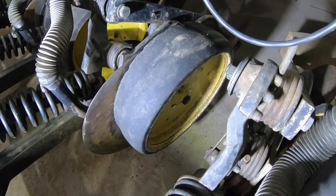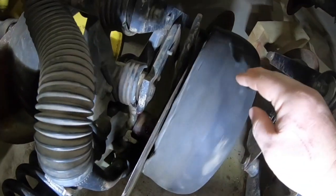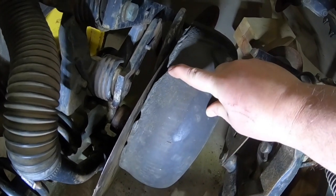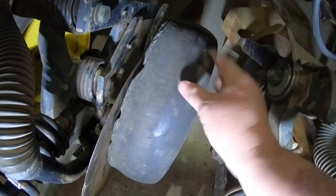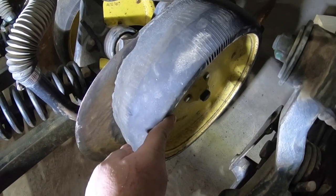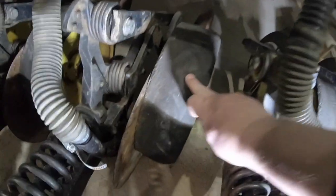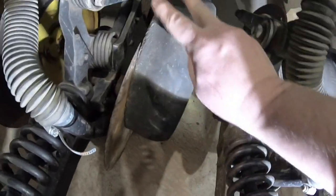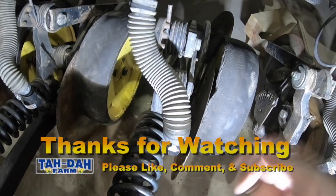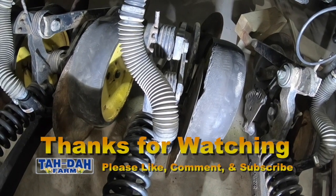I'll show you what we got when we're done. We got the gauge wheel back on. I've got none of these washers or spacers in here and it's still not right — there's too much of this wore off. And I'm sure many of you noticed this gauge wheel has chunks tore out of the tire. So this gauge wheel really needs replaced, and with it still wiggling a little bit after the new bearing, this whole wheel assembly needs replaced. We're going to do that another time. I don't know if we'll get that done before spring planting with surgery coming up. But I had this wheel off too because I had to get that spindle out, so I need to put one of these in here. Anyway, thanks for watching — hope you guys enjoyed this video on changing out this wheel bearing.